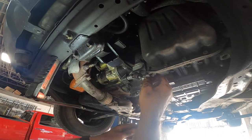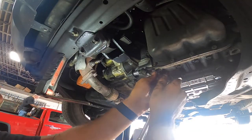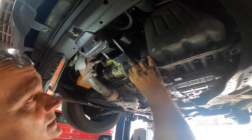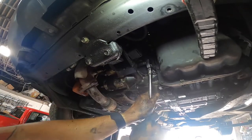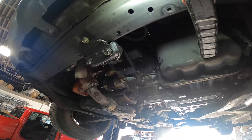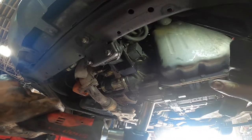After we got the electric connectors off, we're going to go ahead and take the two starter bolts off. This one is a 15 millimeter — actually, might be a 14, and yes, that's what it is. One 14 millimeter bolt. To get the top bolt off, I switched to a 14 millimeter deep well and a ratchet and we'll just get her loose that way. My hands are so greasy, can't even grab nothing. That's a nut — so the bottom one's a bolt, top one's a nut.